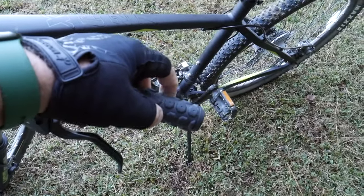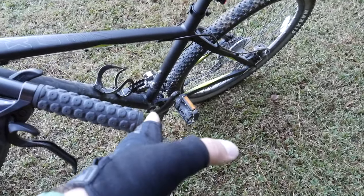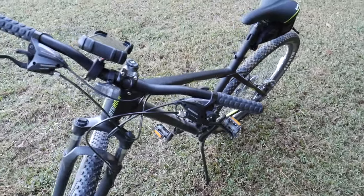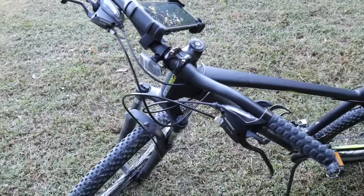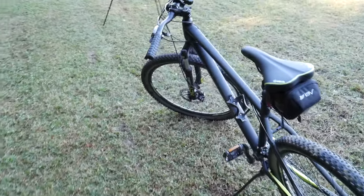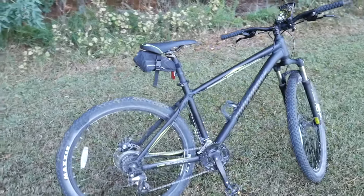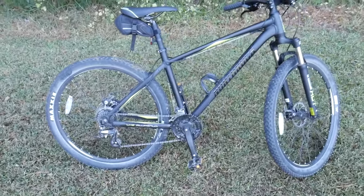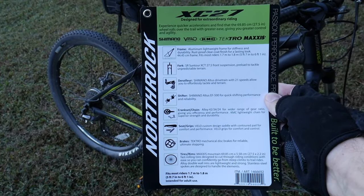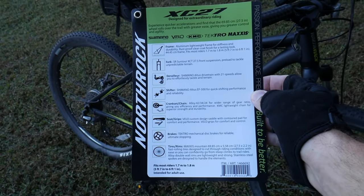One thing to note — I think the handlebars could use some work. I'm not a big fan of these. I could actually maybe put some angled grips on the side as well. For the most part they've done pretty well — I may end up switching out the handlebars someday. No issues with the gears — they change just fine, no searching. Just keep them oiled. I use some lithium grease on mine — clean it off and re-coat every few rides or so.